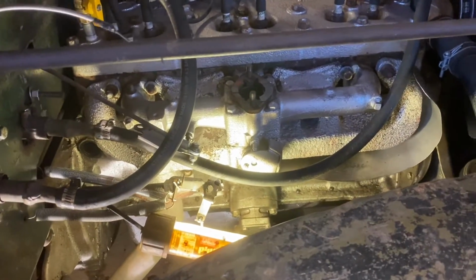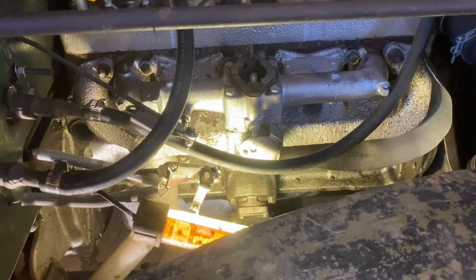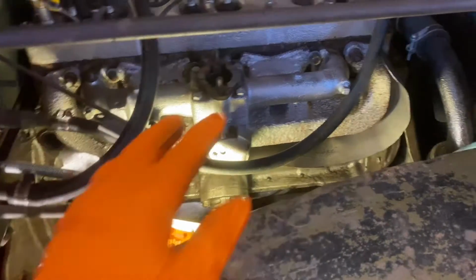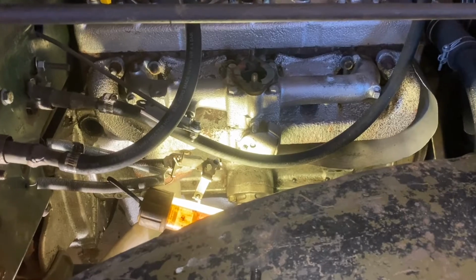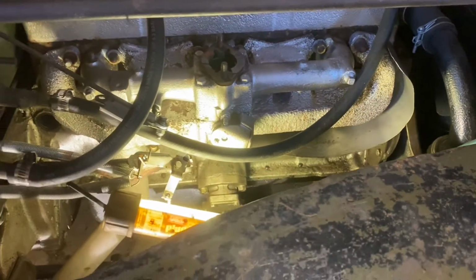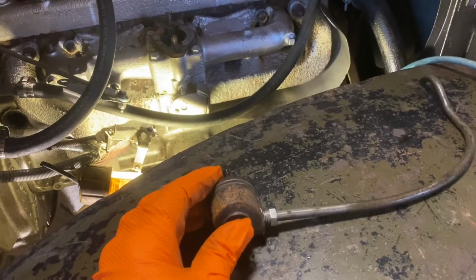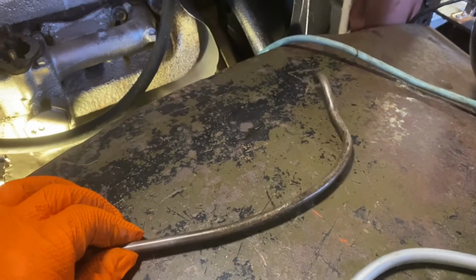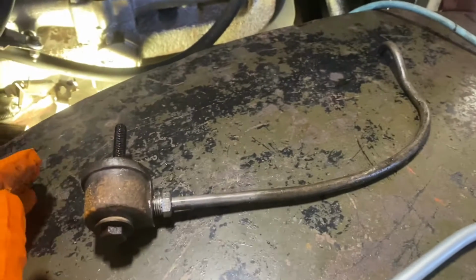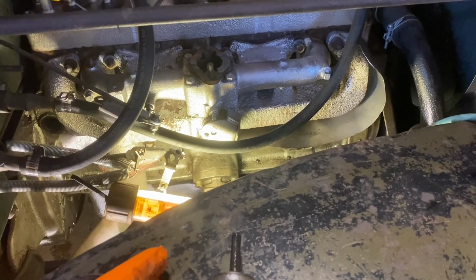So yeah, one of the things that Bob did when he worked on it, probably late 70s, around 80 or so: the intake and exhaust manifold came off of the 46 WF32 because there is no hole here for the PCV valve system. What they had was a road draft tube, the older ones did. He just left this on in that hole there. I stuck this on as a road draft tube, and yeah, I'm kind of spitting a little oil out. Got some blow by. That's kind of expected because I freshened the engine. I didn't do any boring or anything, so that's kind of expected.